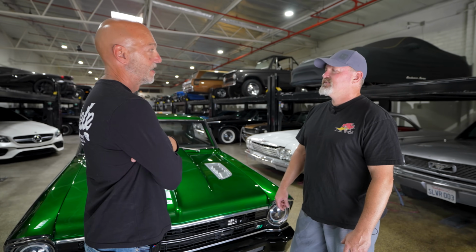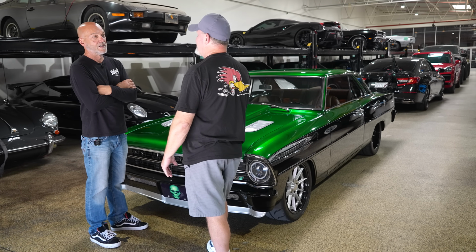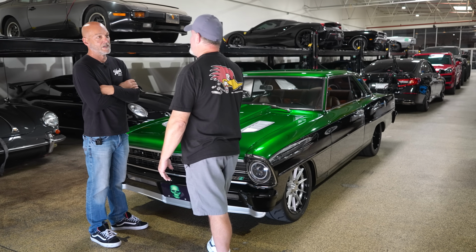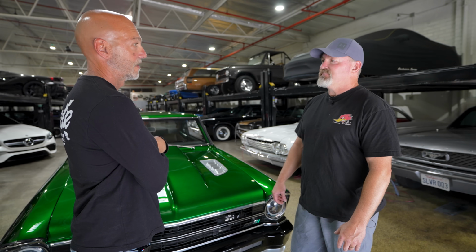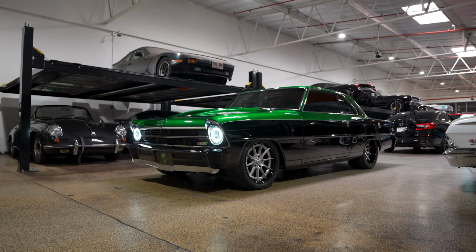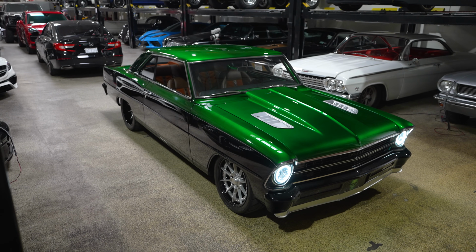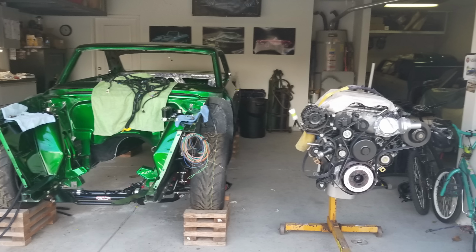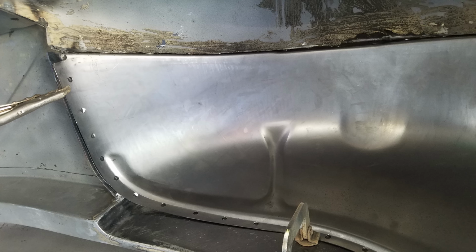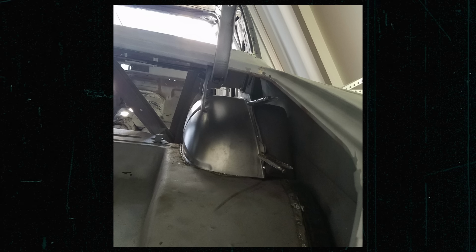It was somebody who had done stuff to it in the 70s and 80s. You know, 327, Turbo 400, 10 bolt in it, old school 300, 350 horse. I think he aged out, got too old, and dreams faded away. I did 99% of the work, everything except the paint. I've done all the fabrication work on it, built the motor, put the tranny in, fabricated the tunnel, fabricated a triangulated 4-link in it, mini tubbed it.